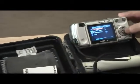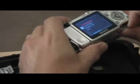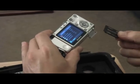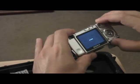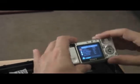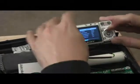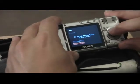One of the things that I recommend, highly recommending, is formatting your memory card. The memory card in the S600, it does require a Pro Duo card. Slides right in here. You need the adapter to put it into a card reader in your machine. Here at the 12 ring, we usually include these in the sale, or it's a negotiated part of a deal when we work out a deal with a customer. So I highly recommend every time you change your card that you format it.